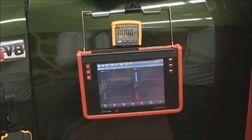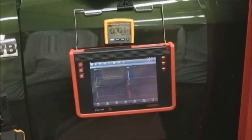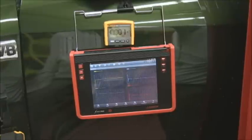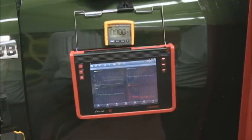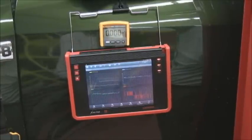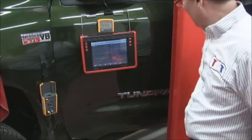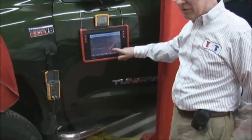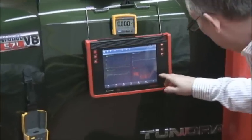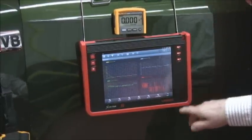When you're checking it, you can really rely on your scan tool. If you think you have a problem, you can hook the meter up in series. Some scan tools will also give you a lambda reading — a lambda of one is perfect, anything above is lean, anything below is rich. And by the way, it's not the scan tool giving you the lambda reading — it's the vehicle manufacturer that programmed that into their data stream. Now it's getting into a mode where it's going a little rich, a little lean — it's pinging itself up and down. It did a little test of itself, a little sequence, and then it'll stabilize.